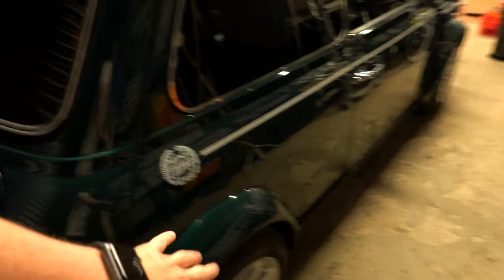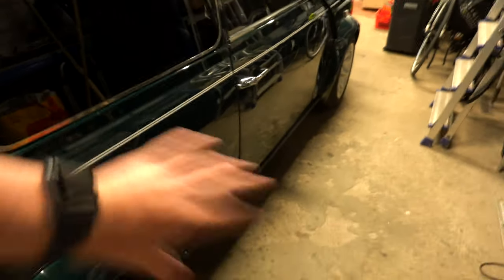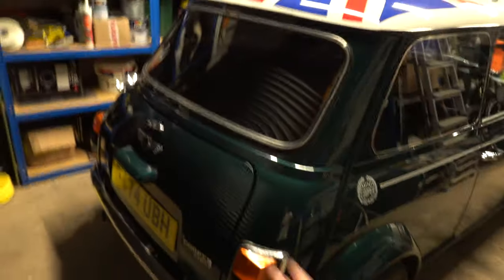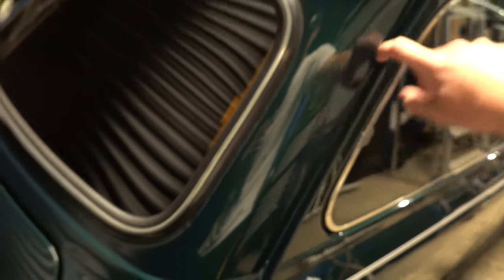As for the sides - wheels need to be done, and obviously all the paint needs to be corrected. I washed it and polished it just so I know what I'm working with. The sides aren't too bad - there are no big rust patches. Coming around to the back, it's absolutely okay. The boot sometimes rusts along the side and around the gully where water runs off the roof and collects. At the moment all I've really got is bits of dirt. There are little holes to drain the water. They've got a bit of polish in there but they're actually fine - a nice solid car overall.